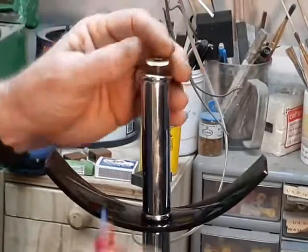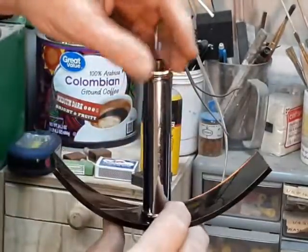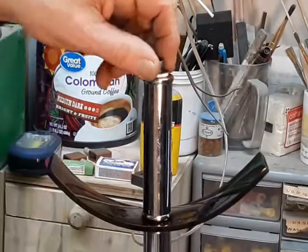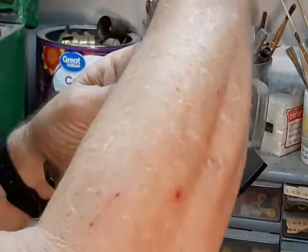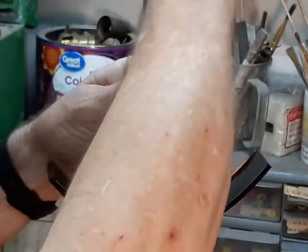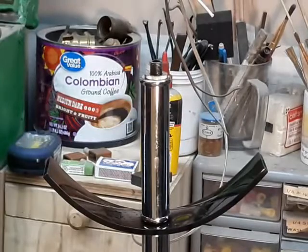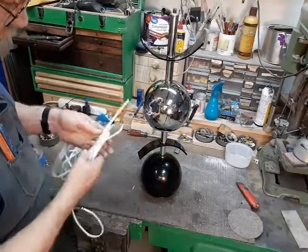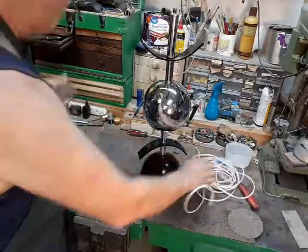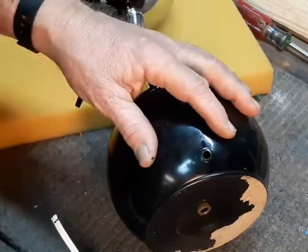I'm putting it back together with a nickel plated nut and a little bit of blue thread lock. With this tall column of pipes and pieces and these black lucite wings, it's not practically possible to get it so tight that nothing can move — what you want is to get it so tight that it doesn't rattle. This is really like a string of beads and there's just a limit to how tight you can get it, but you can get it so that the socket won't rotate once it's installed, and that's what's important. Another improvement our customer wants is a cord 167 inches long.